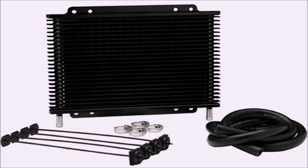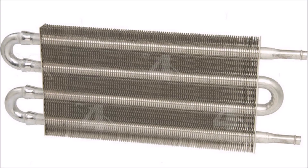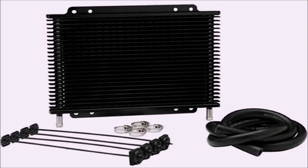My main contribution over the Poor Man Mods design is the cooler itself. They were using a cheaper tube-snake-through-fins design, whereas this is a more effective bar-and-plate style. You can get it in its largest size for $35 off Amazon or eBay versus the $25 design they used. You're only saving about $10 with the cheaper one, but this design is almost 50% more effective and can stand up to the much more expensive coolers sold by 350z specific retailers.